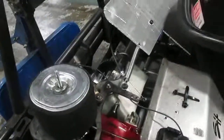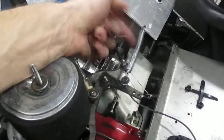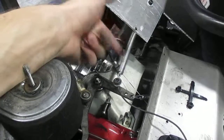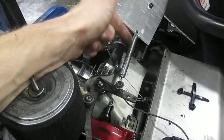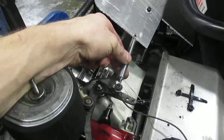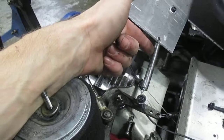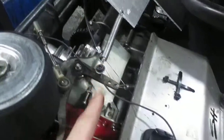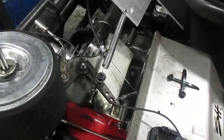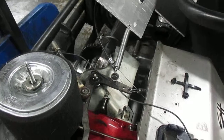The main reason I'm making this video is because last week I came in and three karts were missing their throttle return spring. Today I came in on a Sunday morning to fix a kart with a throttle problem, and all it was was this spring missing. If you're walking around the track and you notice a spring like this out on the track, you need to find where it came from — chances are there is a kart running with no throttle return spring. Without that throttle return spring, somebody's going to step on the throttle, it's going to stay open and not return all the way, and the kart is just going to want to take off all the time.